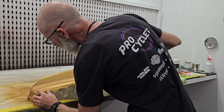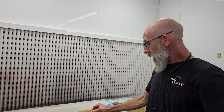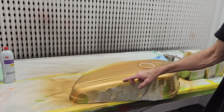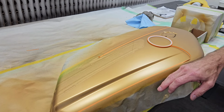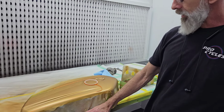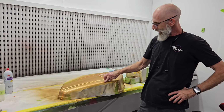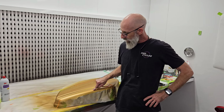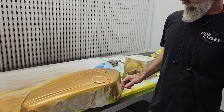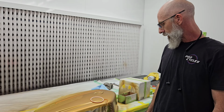All right, what step are we on now? What I'm doing is actually laying out the pinstripe. It's going to be an 1/8-inch pinstripe on the gold. Because the base color of the bike has already been sprayed, we have eliminated the exterior of the bike color. And I sprayed everything gold inside the actual pattern. I'm going to lay out the pinstripe in 1/8 inch. And that'll get masked up, and everything else will start to transpire inside the perimeter of the pinstripe. And we'll just keep adding layers and graphics and artwork until it's completed.